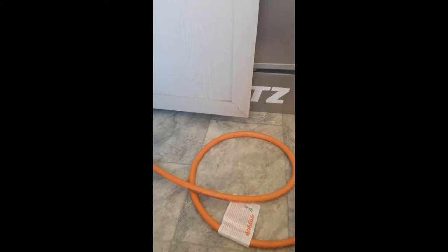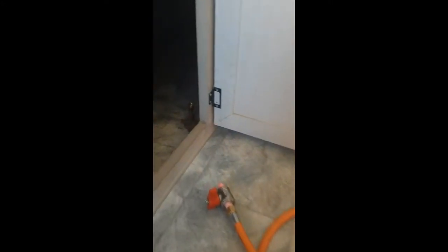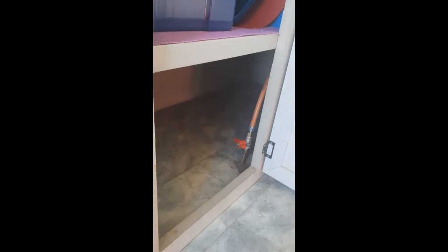This is the ball cock or tap that was already on the flared fitting. We've gone and bought a flared fitting flexible hose which is LPG rated. I've already got my hole drilled through the side of the van. Once I get that all connected up I'll take you outside and show you how easy it is.